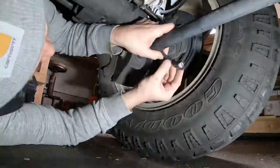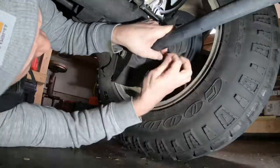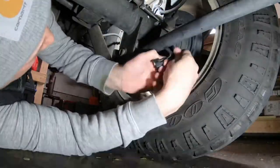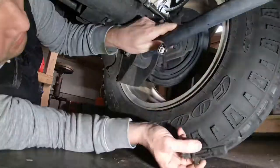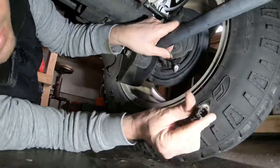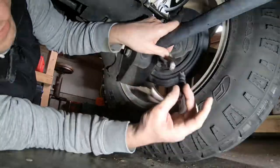Alright, so here's the old harness. It's got a little bit of electrical tape here holding the protective cover of the wire. So I'm going to go ahead and remove this to get better access to the full wire, and slide it out a little bit. When I'm looking at the wires there's not an easy way to tell which one's positive and which one's not. But if you look inside the old sensor, it does have a marking that says positive or not positive on the inside.